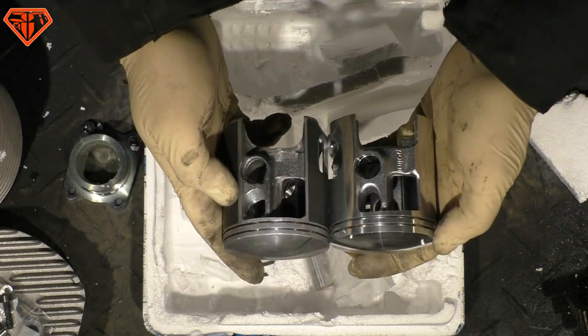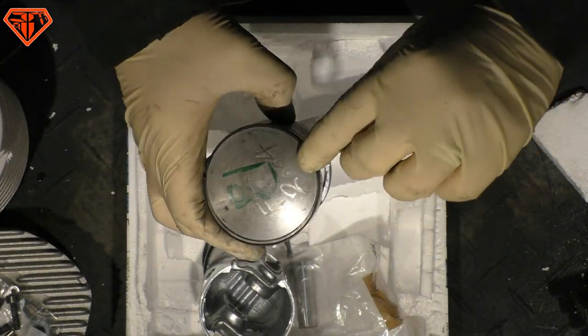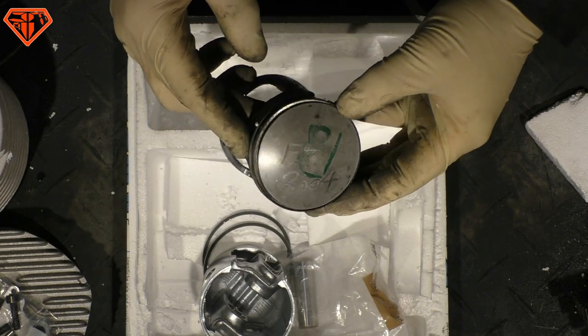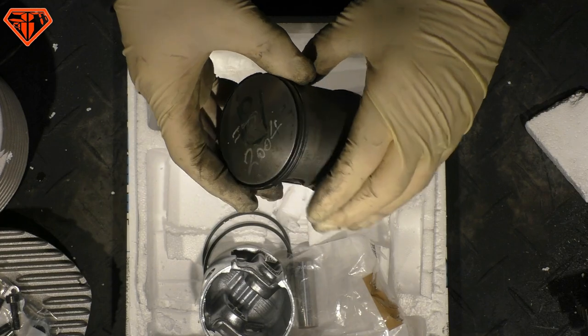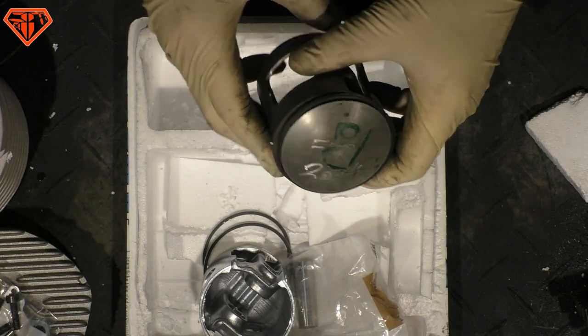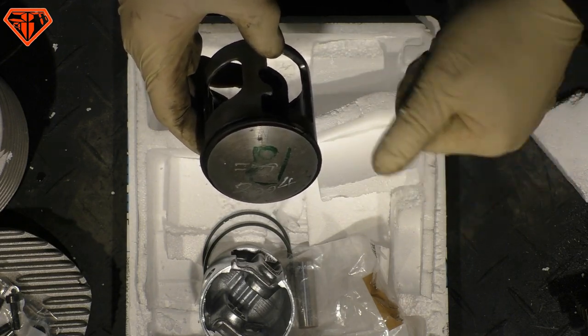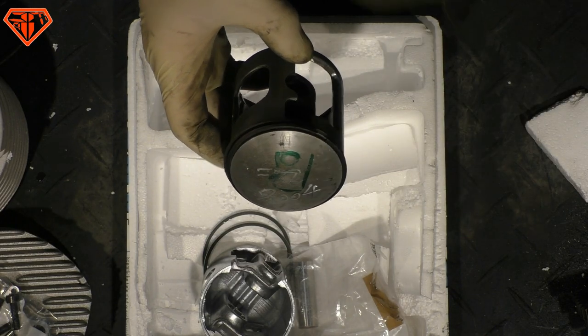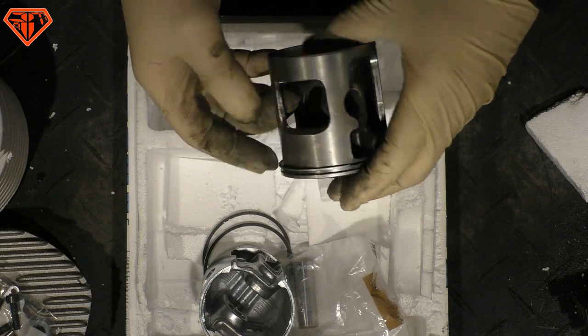But in general, they're all the same type. Oh my, look at that. That's from 2004. Wow, that's nearly 20 years ago. It's still running. It's an old-tuned Pinasco 213, the one before the Supersport with these dangerous fake L ports. I opened the transfers and set the timings 20 years ago.